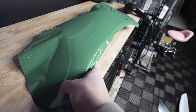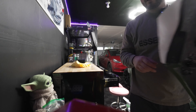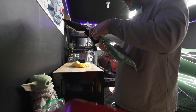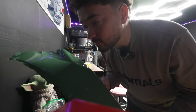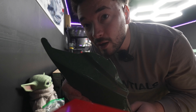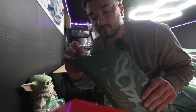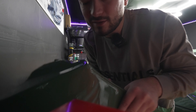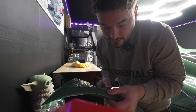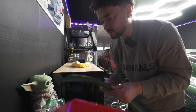I'm going to get around the corners and then that'll just pop itself out, hopefully. I'm actually pretty happy. That one crease I was having a lot of trouble with — which I think was right up here — we kind of got the wrap on. The way I got the crease out, I just kept heating it up and working it, heating it up and working it. I guess that's just what you've got to do with wrap: heat it up, pull it off, heat it up, pull it off. Just keep going until you get it.